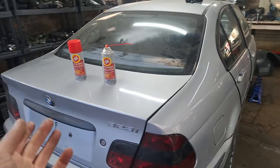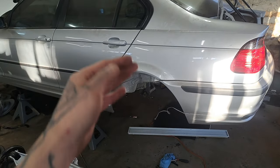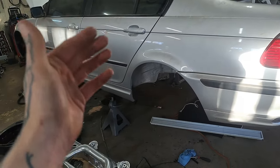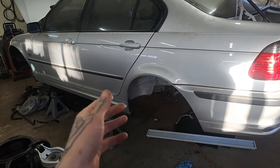Then I'm going to put the plugs back in and call this a job done. We're going to do both sides because those plugs exist on both sides of the car. I've already gone ahead and filled this whole wheel arch with Fluid Film — the wax, or whatever you want to call it. Once we have all the cavities filled with the wax or rust inhibitor, we're going to put the plugs back in and call that a job well done. If you found the following footage to be useful, feel free to subscribe to my channel because I highly appreciate it. I'll see you guys in the next one.